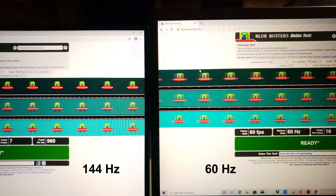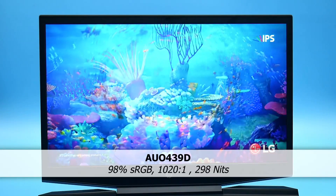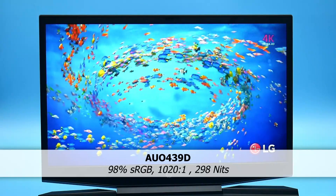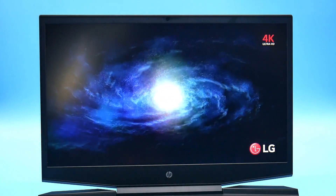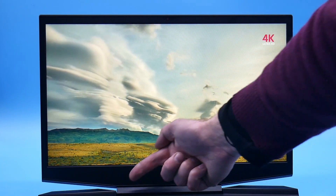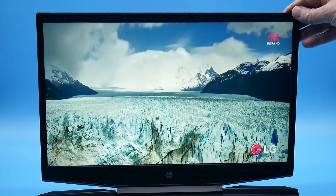The AUO panel may only be 60Hz and as such it is going to be more susceptible to ghosting than a 144Hz panel. But it does have good colour gamut at 98% of sRGB and good contrast of 1020:1. I found it plenty bright at 298 nits, and for general content creation work and casual gaming it is perfectly fine. Like the 15-inch, you have the central hinge which is more prone to screen flex should you grab the screen by the corners.